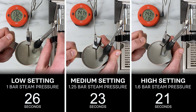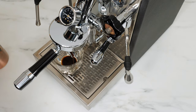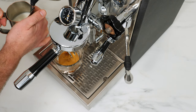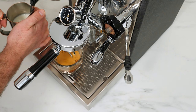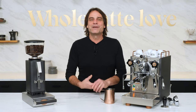If you're newer to frothing it could even be too much, but those with experience are sure to appreciate the added steam pressure. I do not recommend using the highest temperature setting for making espresso, but once you've started an extraction, you can easily flip the switch to high for more steaming power without changing the brew temperature. You'll reach max pressure in about 30 seconds, but can certainly start frothing immediately and have pressure building as the boiler continues to heat while you're steaming. You can think of it as a turbo froth switch. Just be sure to set the switch back to the middle or front position as soon as you're done frothing so the boiler drops back down to espresso brewing temperature.